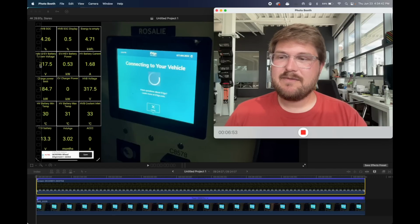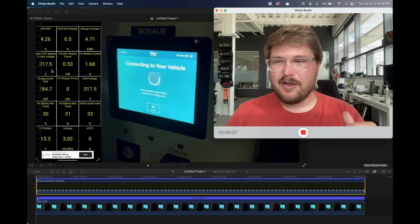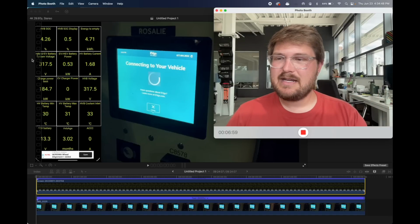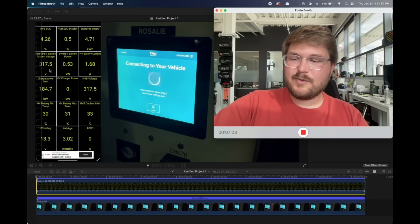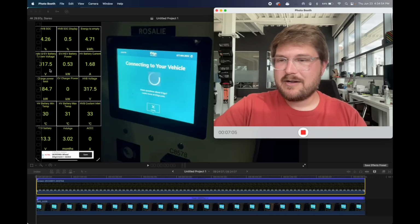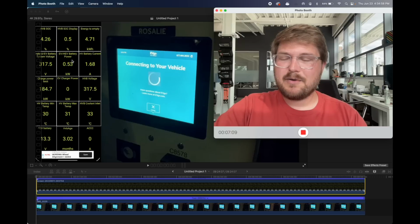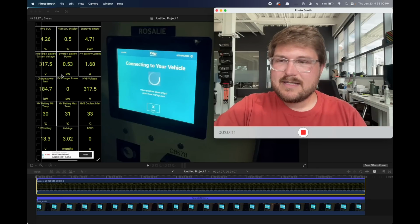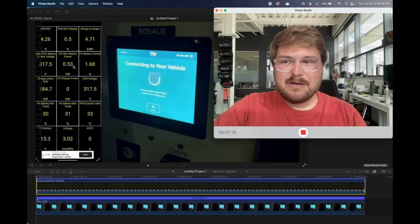Over here is our total system voltage of the high voltage system. So 317.5 volts dead, really, really low voltage, especially for modern EVs. And again, they can work their way around it, and that's fine. It's not the end of the world, but it just requires a lot of charging current to do it. Here's the real-time battery pack power, what's going in or out. So while it's going to be DC fast charging, this is what's going to make it into the battery pack.